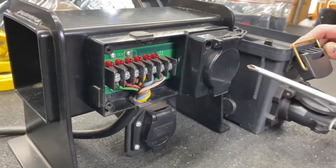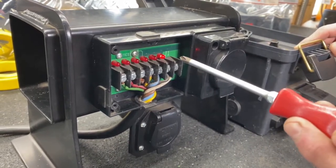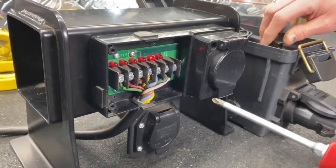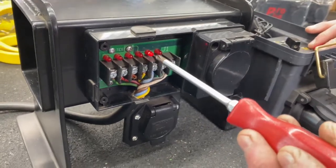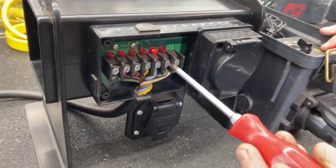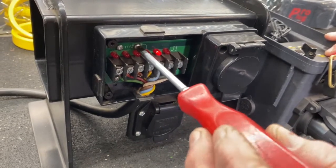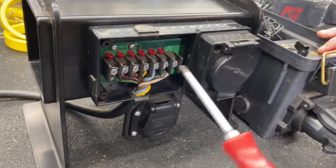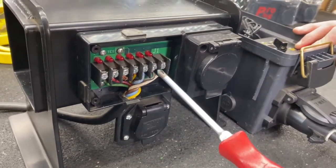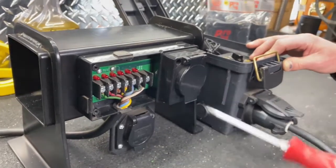So for example, when you've got the 12-volt circuit hooked up the bulb is on, and then of course your electric brake light is here. And those two bulbs - if you want to shut those off, that has absolutely nothing to do with the completed circuit. But if you want to disable the bulb you just give that a quarter turn. Now the bulbs are disabled but the circuit is not interrupted - it just disables the bulb so there's no parasitic drain from the LED bulb.